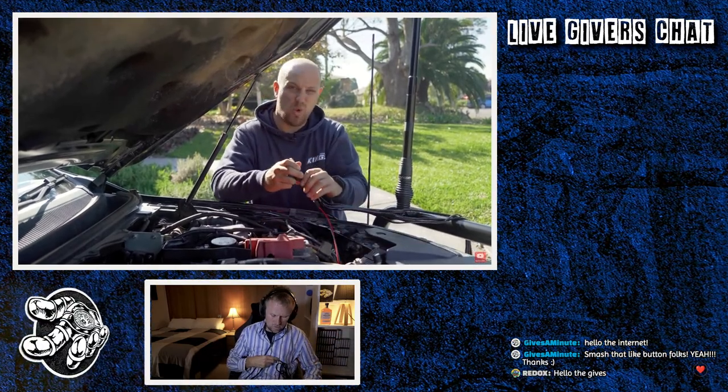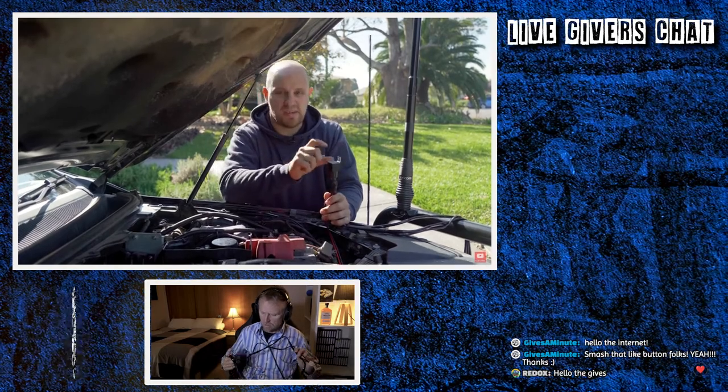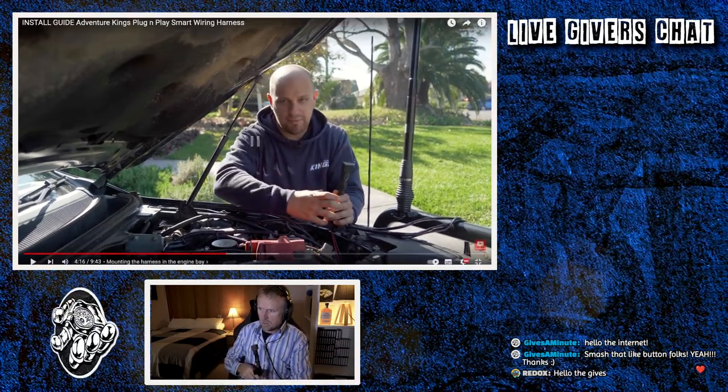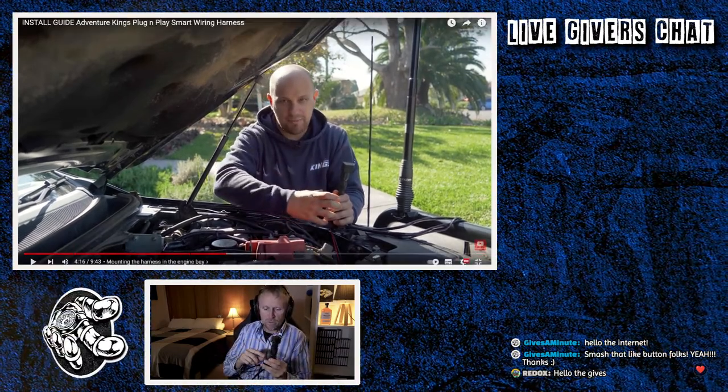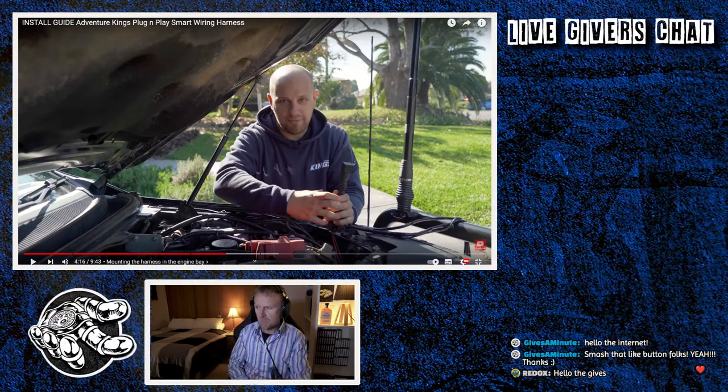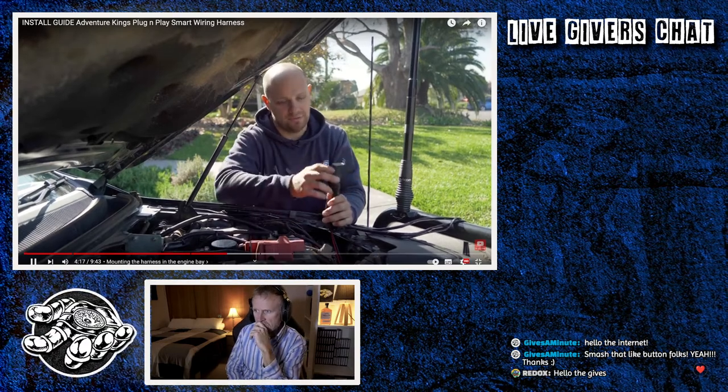What you don't want is this wiring to come out at an acute angle, because in a worst case scenario, you can actually pull the wiring out the back of the relay holder. So ideally what you want is somewhere that you can mount the relay that has about 3 or 4 inches of room underneath it for the wiring to fall away. Interesting he's saying to make sure that the wiring falls away, because don't forget you still got to get in to get to that fuse as well. That's before it starts to curve.